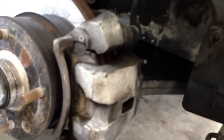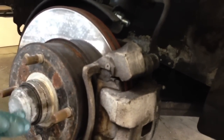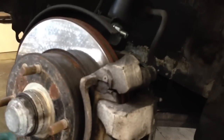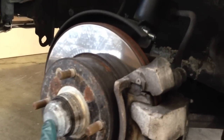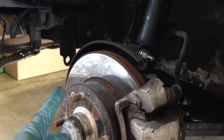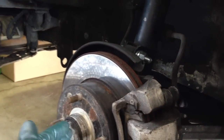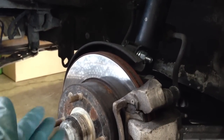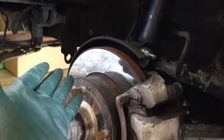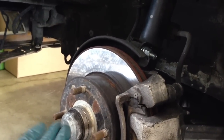When that's happened, you have got some amount of weight transfer off of this corner, so it's as though the car is on the ground — not completely, but it simulates that to some extent. So say you measure, for example, 13 inches with this measurement. You're going to likely have another quarter inch to potentially half inch of lowering if the car is actually on the ground, but this will give you a good starting point. So if you get 13 inches here, you can assume it's going to be more like 12 and 3 quarters when it's actually resting statically on the ground.